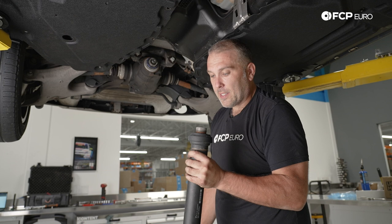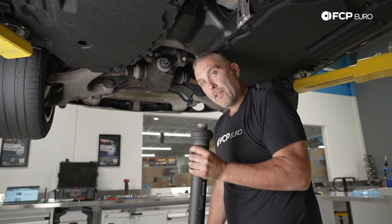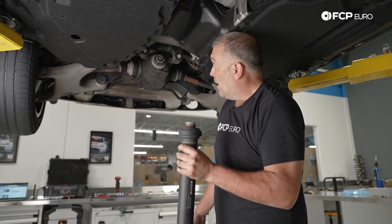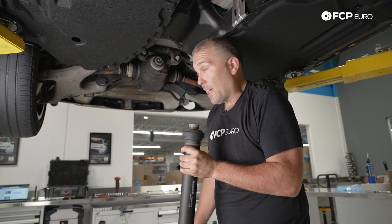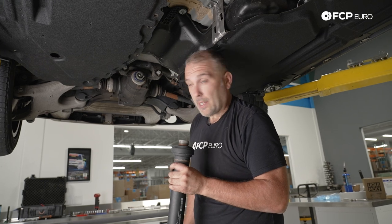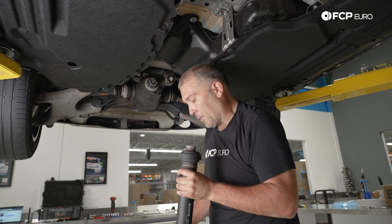So what this ends up doing is not only push down on the portion of the drive shaft so that it's tight, but also set the length so that it can't possibly come loose. It's an interesting design. I personally am not a fan of it because you do need special tools, but from a manufacturing standpoint that's only one fastener to deal with as opposed to four, six, or eight. It also removes any ambiguity as to when it's actually installed properly.